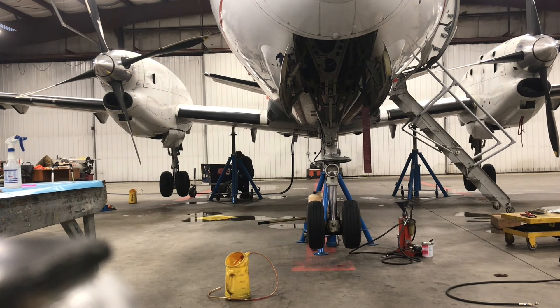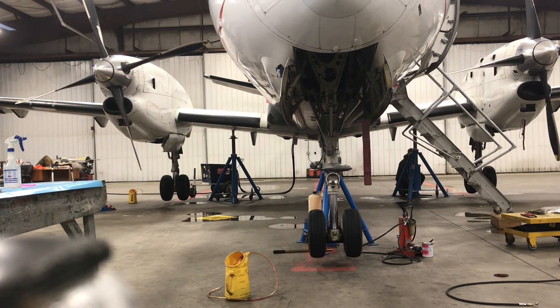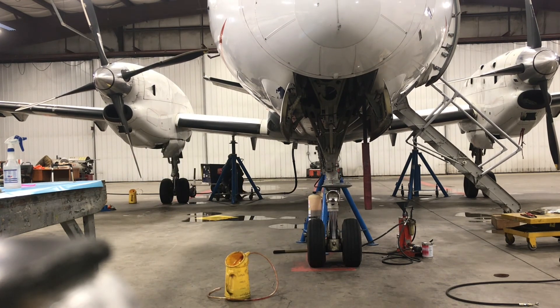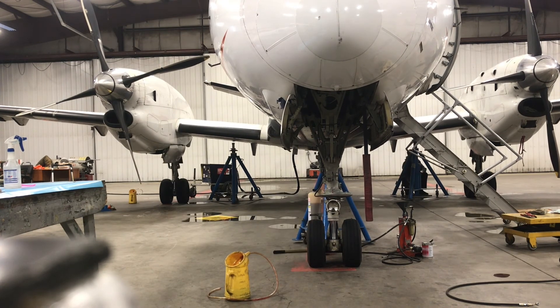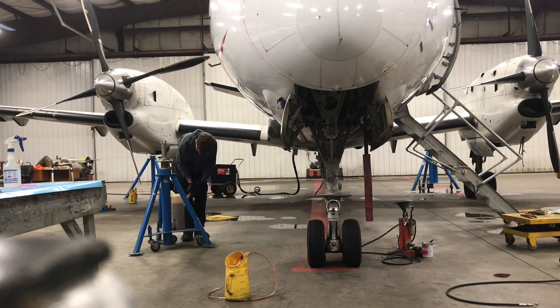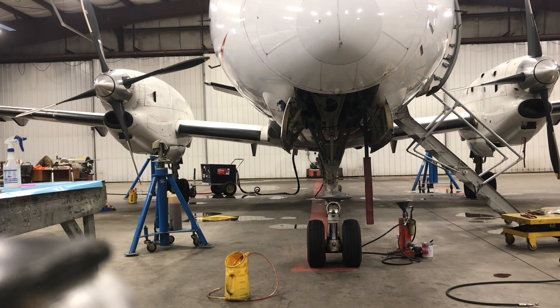And that concludes a strut service. The mains are the same principle — it's just the oil drain valves are on the back of the strut, not the front. I was by myself today doing this, so it's kind of a pain jacking an airplane alone, but I made it work. Good practice on any airplane: as soon as the jacks have lowered enough to get them out, don't put your hand on top of them — the airplane might settle — but rip them out quickly just in case. Here I am now just checking the strut lengths and fine-tuning by adding or letting some air out with the nitrogen. And that's it.